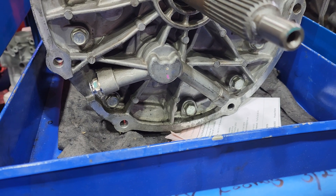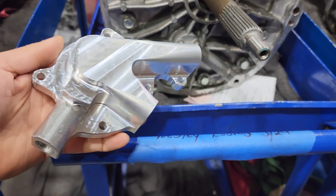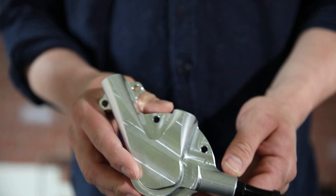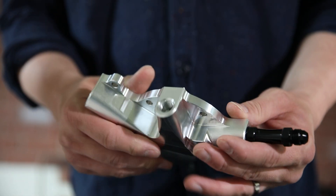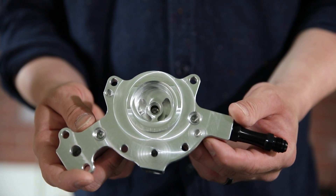We do plan to offer this with diff bracing as well. Now we have a mechanical pump option that goes into the plate just as Tremec offered with their TR6060 builds. We've machined the housing that accepts a billet gear set to drive and flow oil. You can use it with an oil cooler, and you can still use it with the spray bar. It functions as both a cooler and it would take the place of the electric pump in a lot of applications.